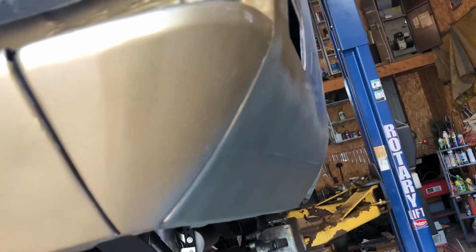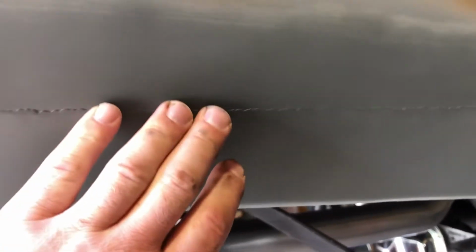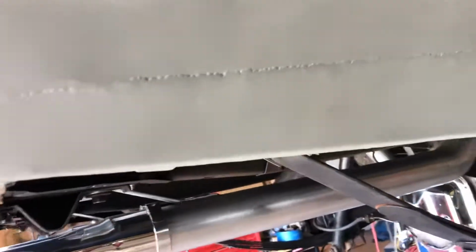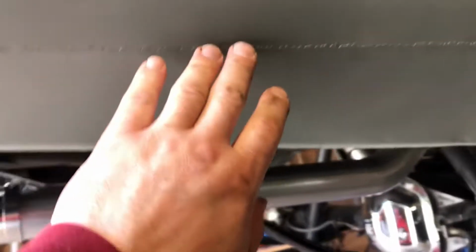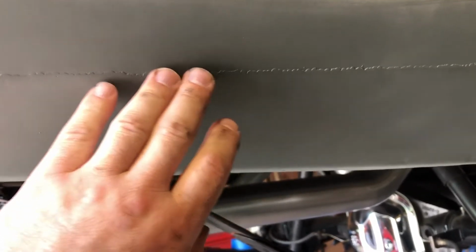You can try to see it. It should be pretty good. I've been told by the guy who's going to paint it and do the filler work. It didn't come out perfectly butt welded, which angers me because it was fit in there pretty well. And when we tacked it a couple times, it pulled up and bound. I actually had to flex it out and grind some on the top, and it fit back in.